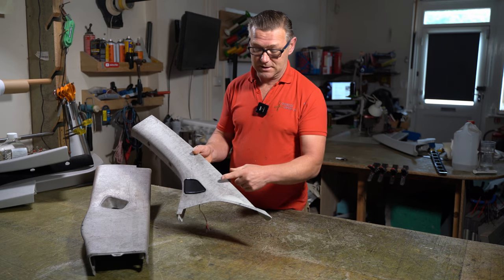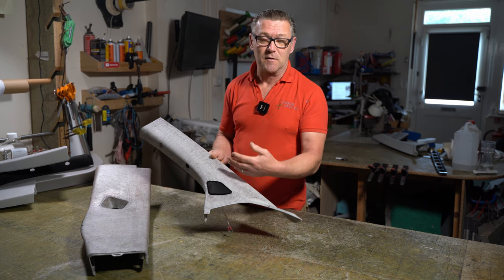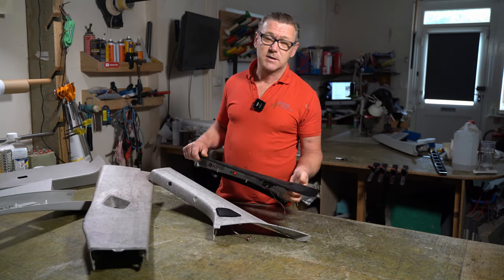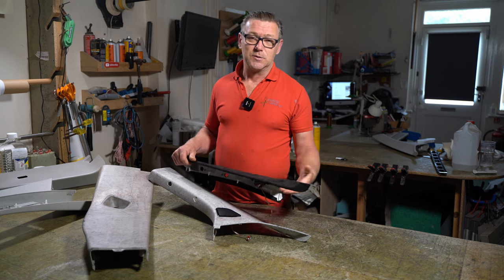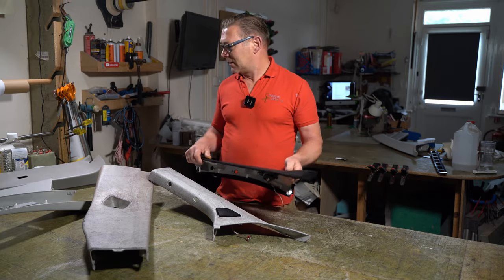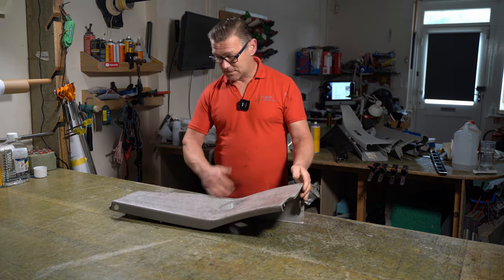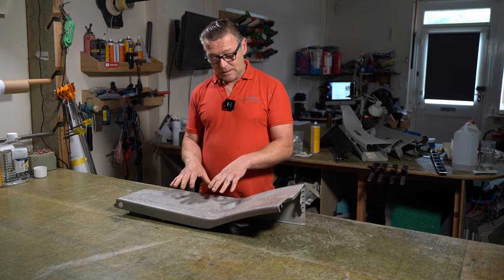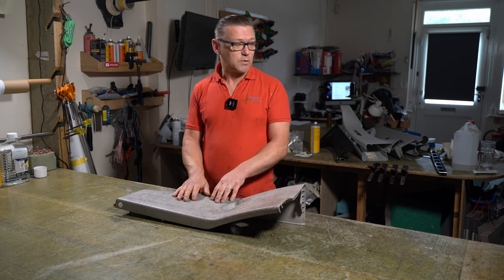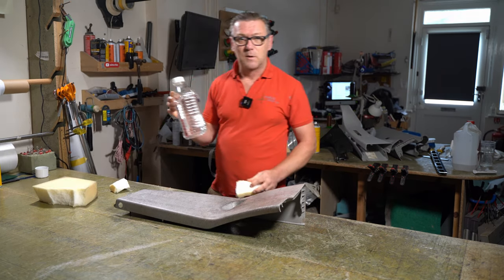It's come away. You can see the dirty glue where the colour of the fabric has gone into the glue. So you need to make sure that the fabrics that you use are suitable for the glue that you're using, or vice versa. And if you have a trim piece that has been glued, the cover's starting to come away, then this glue will, chances are, be easy to remove. All I'm going to use to do that is white spirits.